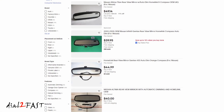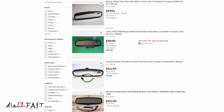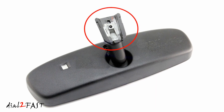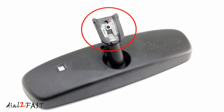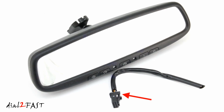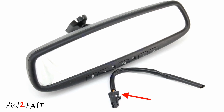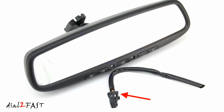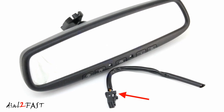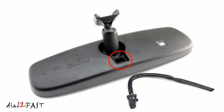If you're shopping for a used mirror on eBay, a couple of things to note. First, make sure you have the correct mount that will fit your vehicle — depending on the make and model, they do have different mounts for different cars. Second, since you're installing this mirror in a car that's not pre-wired, make sure the mirror comes with a wiring harness. The seller would have had to cut the wiring harness from the original vehicle and include it in the sale.